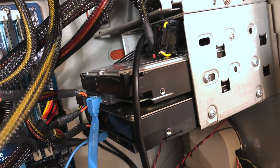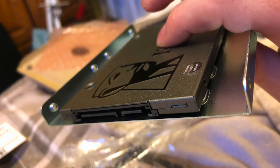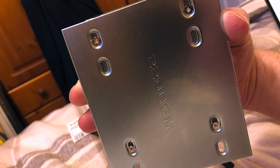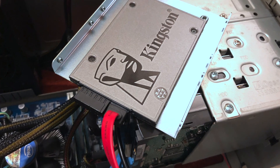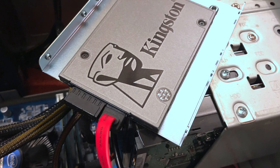Here you can see the old noisy spinning disk drives. So in order to use this solid-state drive in my ATX case — which is a fancy name for the size of my particular dated 90s computer case — you need to use this little metal tray. There are screws provided to allow you to attach the solid-state drive to the little metal tray, and this is what you will later slide into your computer case. But for now I'm just going to rest it at the side of the computer, because I'm not sure which of the drives in my computer actually contains my Windows operating system — the one I want to clone.